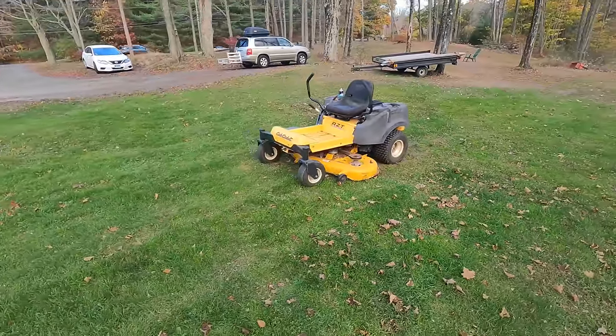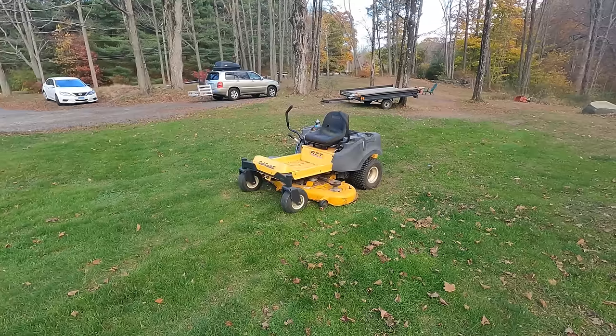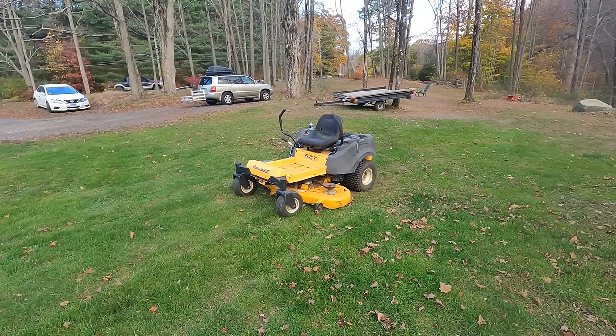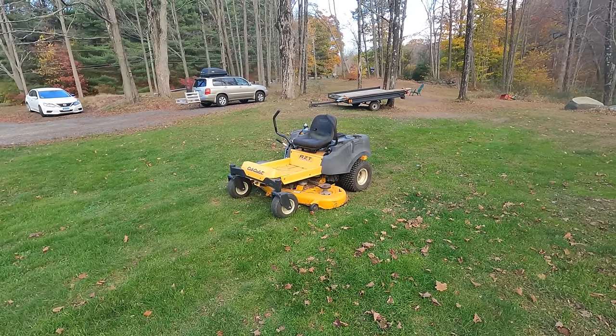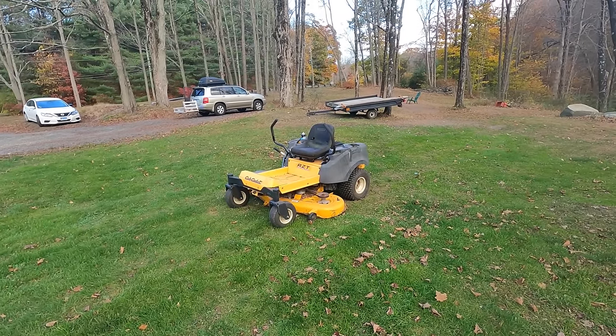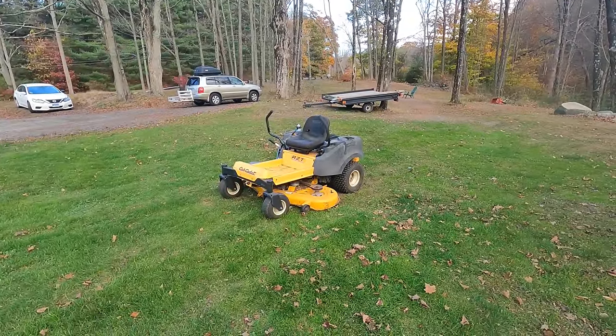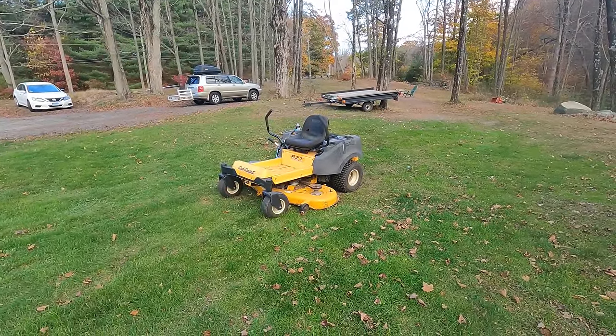And I didn't film it, but I swapped out the fuel pump from the parts engine and put it on this one because it just seemed to have trouble pumping enough fuel. Since I did that, it's running nice and smooth. The trick will be, will it restart? Because it doesn't seem to like to start. It always needed, you know, starting fluid, so we'll see.